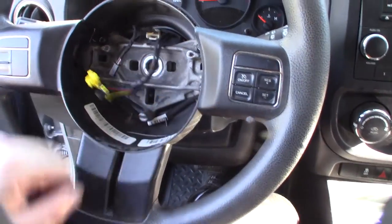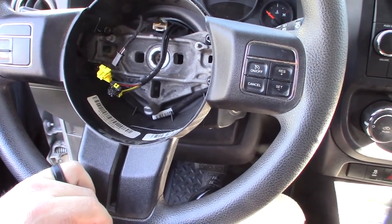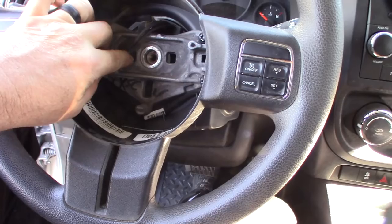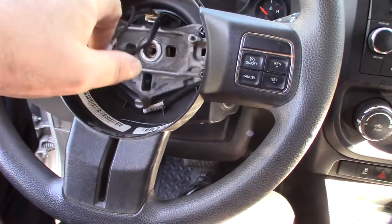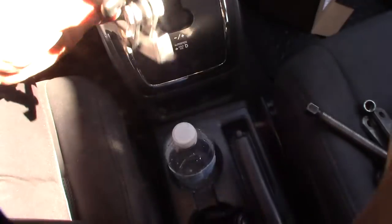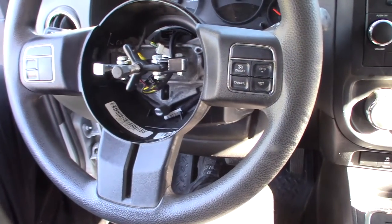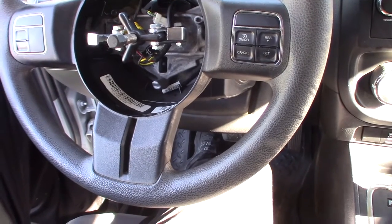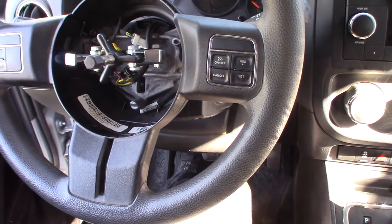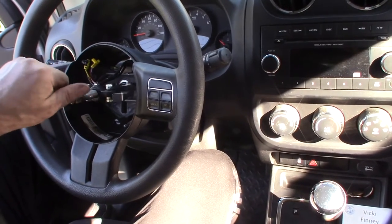The bolt is 13 millimeters. It was actually loctited in there, which made me nervous — I didn't want to break it off. This is a special kind of steering wheel puller; I'm used to ones with three different holes. It's definitely an odd puller — this one can work with two or three. I did get one of my pullers in there. I'll link the right one below — it had little teeth on it, kind of like a crochet hook. That was nerve-wracking; I didn't want to break any parts.